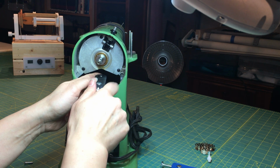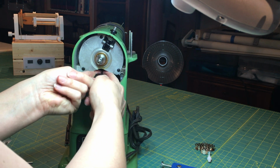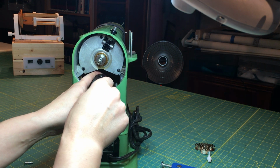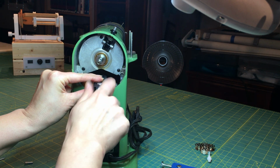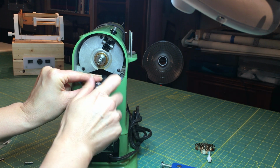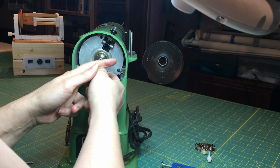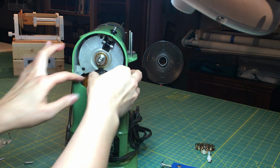You'll feel it get a little bit tighter once it gets to the roll pin, but as soon as you start pushing the roll pin out, you should find that it actually doesn't take much. It's hand tight. If you're pushing harder than that, you're going to bend the pin, and you're probably going to have issues where it's stuck. So anyways, this is now just pushing the pin out. And now that I've got the pin out enough, this is the pulley ready to remove.